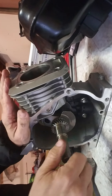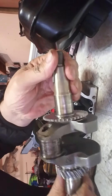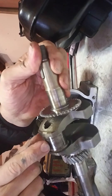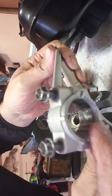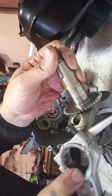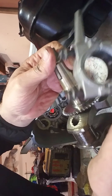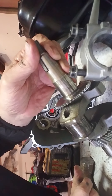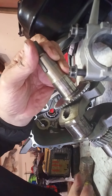The only thing I have left to do is wiggle this crankshaft out — and our crankshaft is out. This part here where our connecting rod goes is called the rod journal. This is where most of the wear on a motor happens. This is steel, this is aluminum, and it winds up wearing out — it gets what's called too much clearance. It creates what's called a rod knock. So when people say my motor is knocking, more than likely it's knocking on this journal rattling around. There's a good video on YouTube where a guy runs a motor cut in half with no oil, and you see all the slop on the rod until it breaks apart.